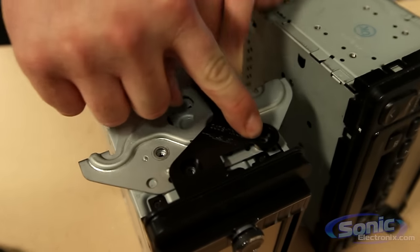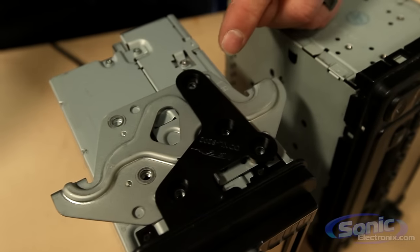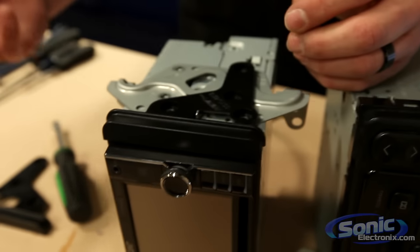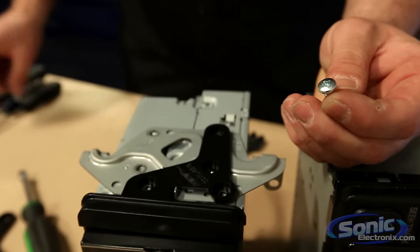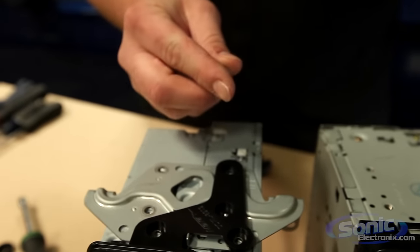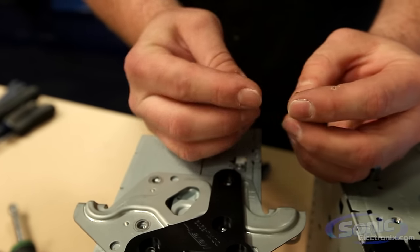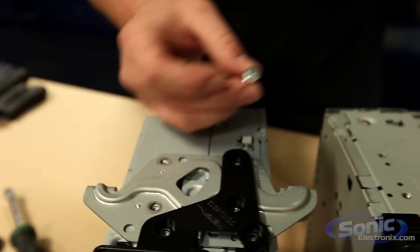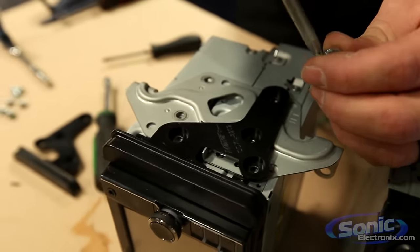You can see how it has three or four mounting holes that all line up. The screws provided with the JVC or Kenwood unit are usually a pan head Phillips screw. We don't use the factory 8 millimeter screws that came on the Toyota because they typically strip out and may be too long — you could damage your unit. So we go ahead and mount our ISO now.